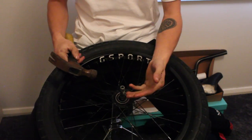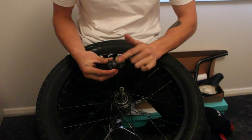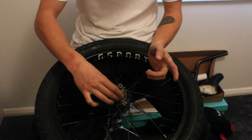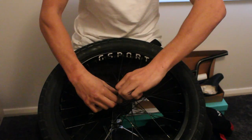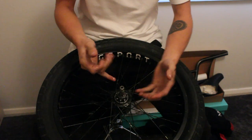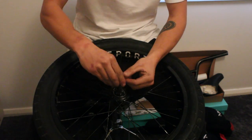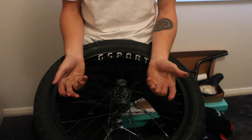That is now seated back in with the axle straight through. Now we're ready to re-grease the driver — grease up the thread, grease a little bit inside it so it slips over the axle, and grease up that front bearing. Then push it in and turn it, holding the axle, until it screws in and stops — it's now threaded back into the clutch. We're good to put on the lock nut, screw it all the way back on.